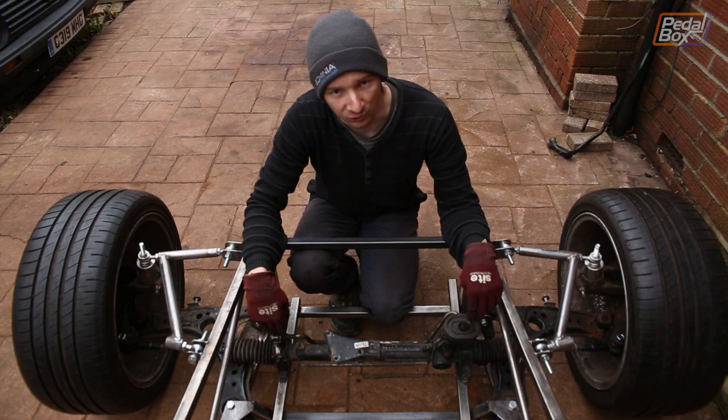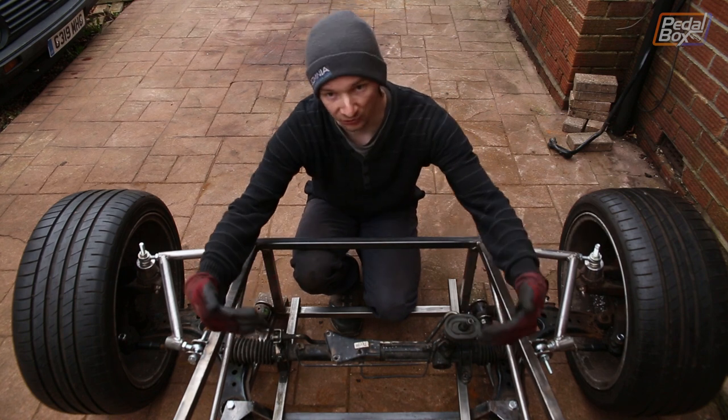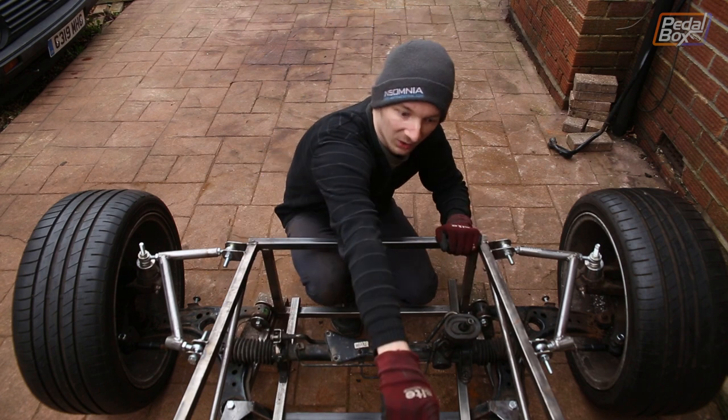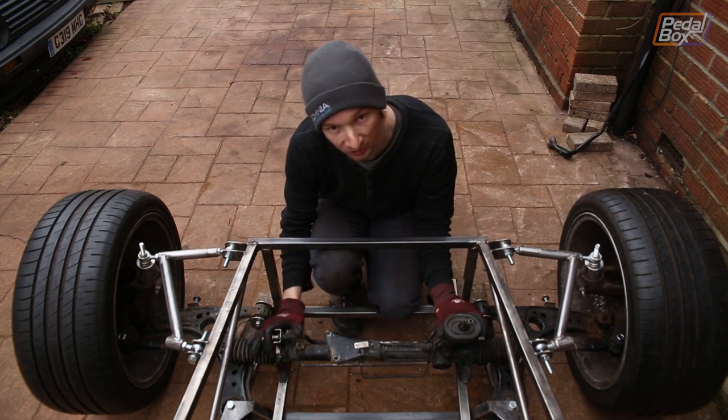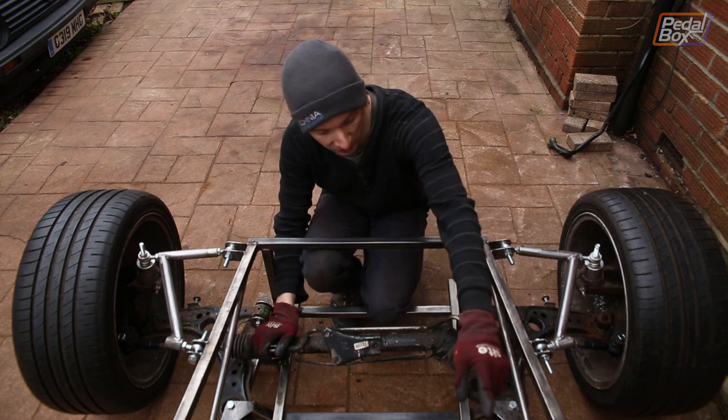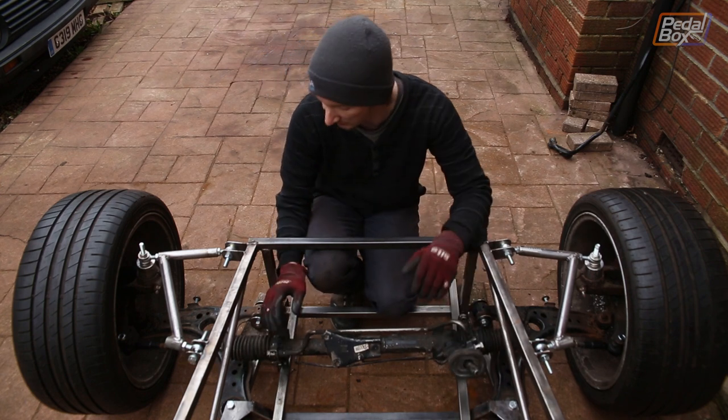In the original subframe, the steering rack fit this way up, right up against the firewall about here. Now that's not very friendly for us because our steering wheel is way back that way and not very high. So we're going to have to tilt this back quite a lot to get a friendly angle for our steering linkages off the steering wheel — we're going to tip it back about yay far.